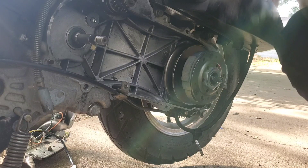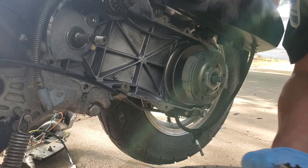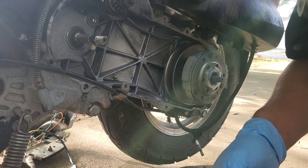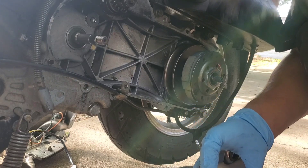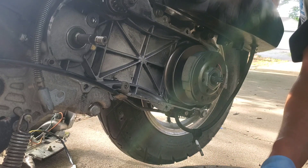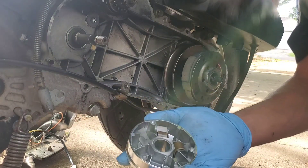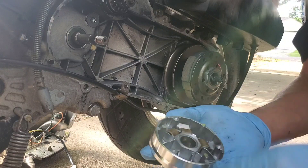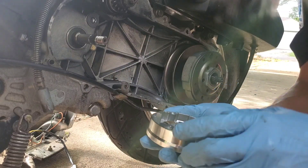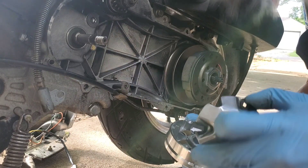They gave you the whole new insert — that's all your old stuff there. And there are those eight-gram weights; you can see how much thicker the metal in the center is. Those heavier ones are mainly used on 150cc engines.